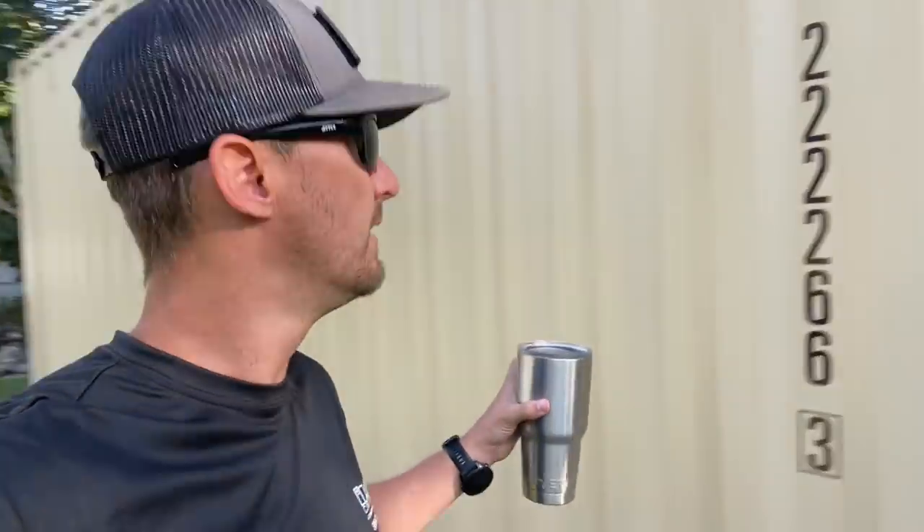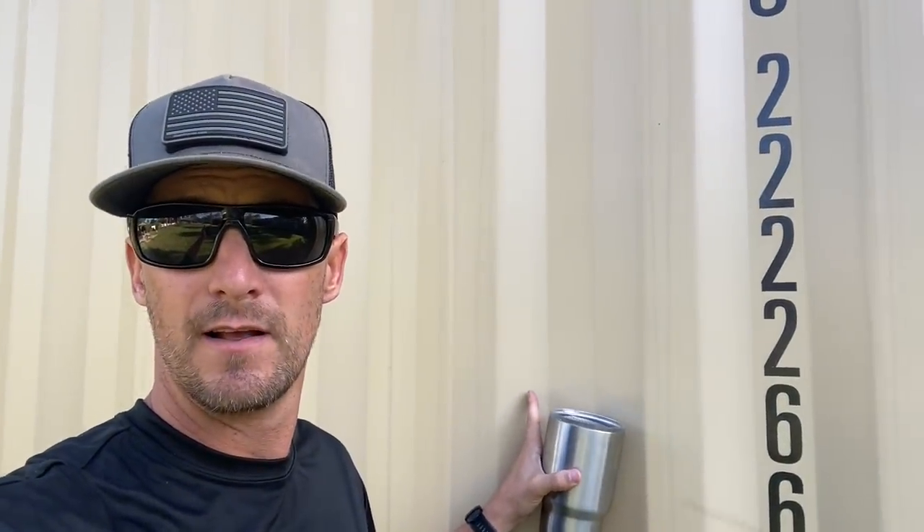So I'm going to see if they have any 2x3s over at Home Depot or Lowe's to fit in the little recessed valleys so that we have something to secure the cool little siding trim we're going to put on this thing. We're going to paint the whole thing gray, but before I do that, I want to adhere the 2x3s directly to this factory paint, which is going to be a much better bond. Then I'll paint it before I put on the siding pieces, but I want that substructure secured directly to the factory paint.